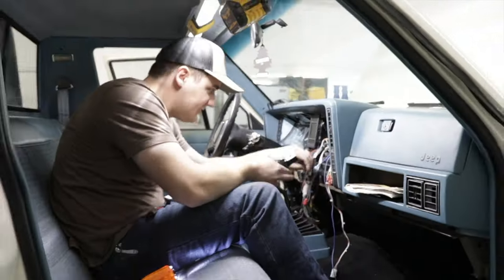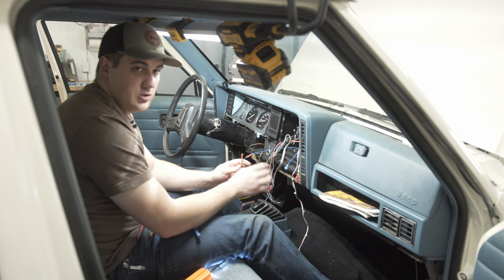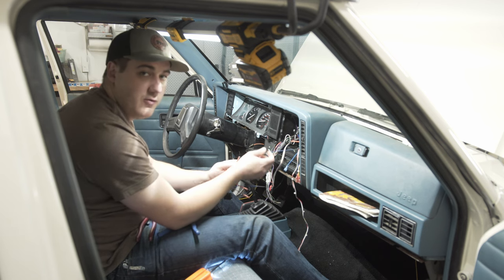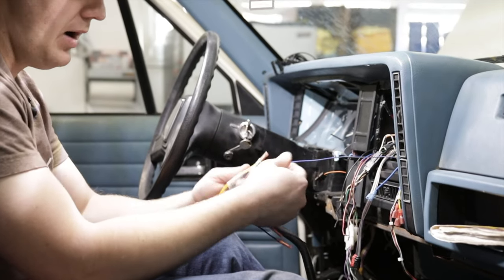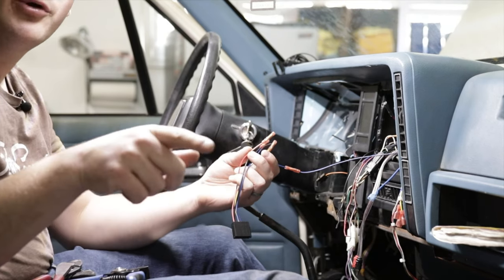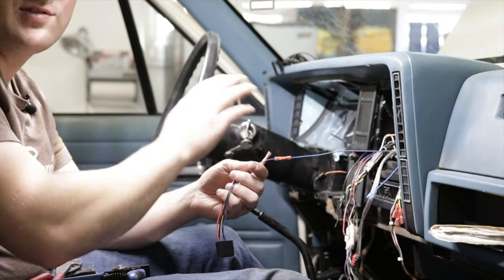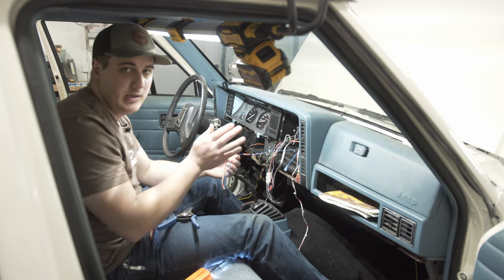The RCA cables go to the back of your radio. The blue amp turn-on wire for the Sub 8100 still gets wired into the male pigtail from your radio just like normal — this pigtail flows through your quadraphonic but will still kick on just fine. Don't think you need to splice it somewhere else; just wire it to the amp turn-on on the regular pigtail and you'll be fine.